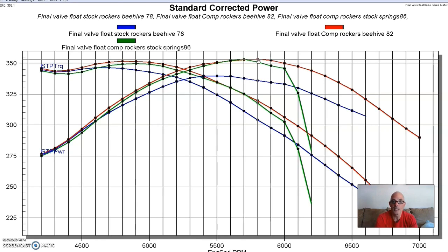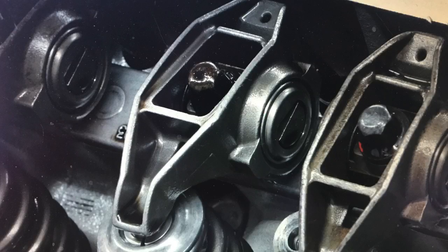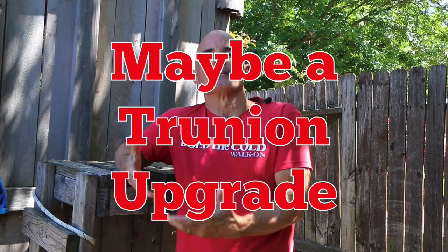If you're going to put roller rockers on it, make sure you upgrade the valve springs — otherwise valve float. Now for our conclusion: do I recommend roller rockers? I don't usually recommend anything, I just test them and show you what they do. The factory rocker used on an LS is an excellent piece. The design is amazing, it minimizes deflection, it has a roller fulcrum pivot point, and it reduces friction. Guys are using it above 8,000 RPM, and the reality is the factory rocker can service about 99% of the LS public out there.